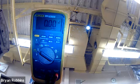Now we have our test leads all hooked up, sitting inside the vehicle, key ready, vehicle disabled so it won't start. We're going to put in the key, turn it, and crank the engine over. We want to crank the engine for a maximum of 15 seconds — as little as we possibly can — to avoid any kind of damage to the starting system. Just while the engine's cranking, we'll get our reading. I was getting about 0.13 volts, which is completely acceptable for this particular vehicle.